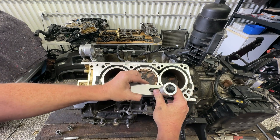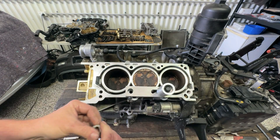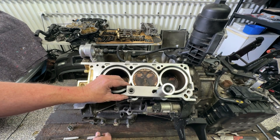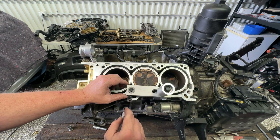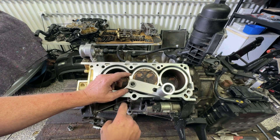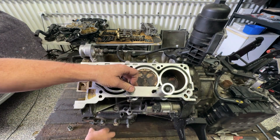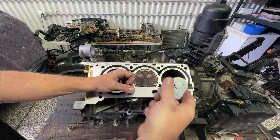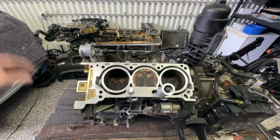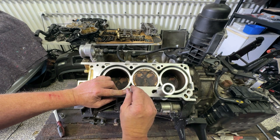Just make sure that's nice and clean. We'll start winding that down, put the little insert in there and tighten it up. While this is still loose, I want to use this taper in that hole and just line things up. You've got to be careful you're not going to go into the wrong hole — make sure you put it in the right hole. Tighten this down; it doesn't need to be super tight but it needs to be firm. Double check everything to make sure that hole is still centered and didn't slip while you tighten things up.